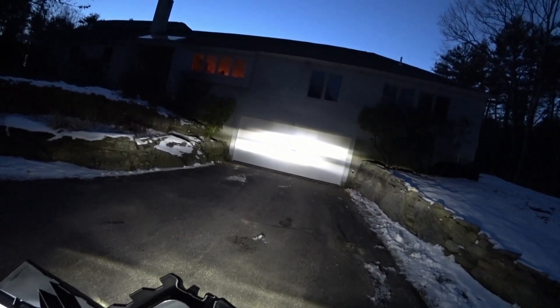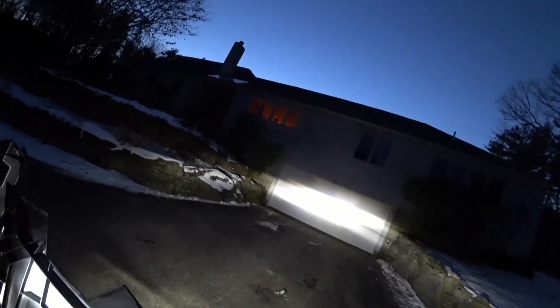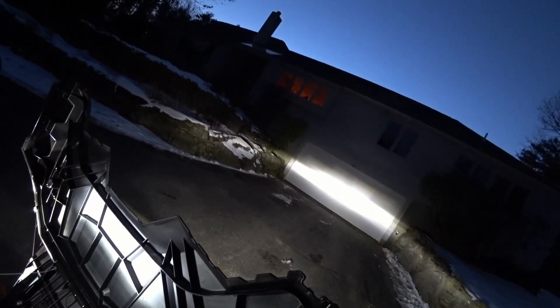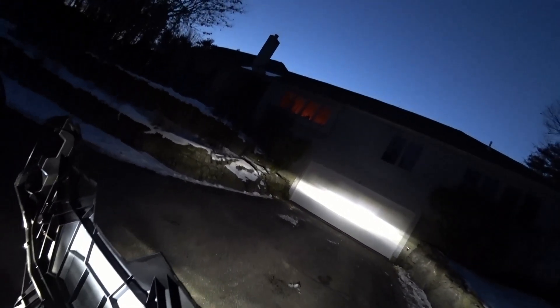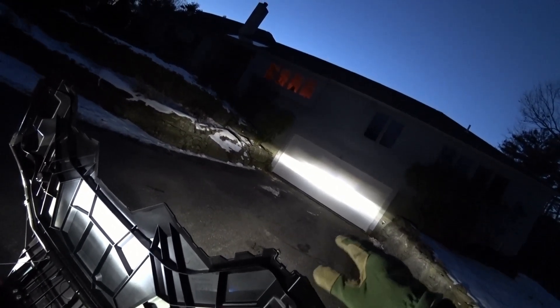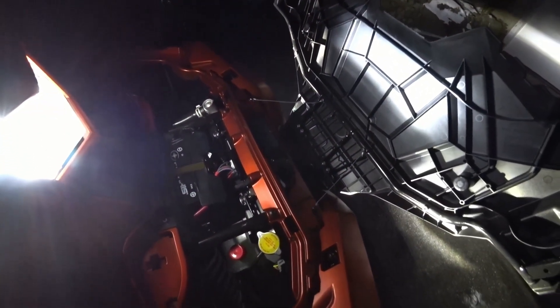As you can see there's a big difference from where it was to where it should be. It's really tight but it needs to be adjusted properly. I'm going to overlap the low beams slightly — center one on 32 inches and the other on 35 — and see how that works. There's a lot of tension when tightening these housings and I don't want to strip out the plastic threads. Low beams on this machine are done. Let's try the high beam.